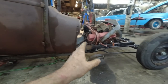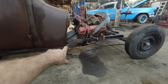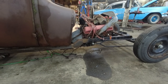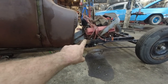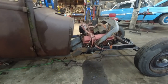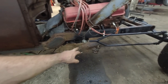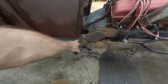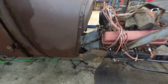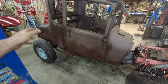We'll get this placed up. We'll get the small block kind of set up. Then we can figure out how much we're shortening this. We're going to kind of hack out what this feller did here. We're going to make some new fish plates or something to go on there. Basically that pin, to me, with this front end, if it works, this should be back here, but somewhere in that vicinity. Looks right to me. If I was doing a truck or something, I think I would just slide the whole body ahead and then kind of make that work.